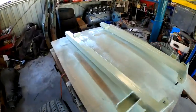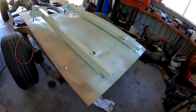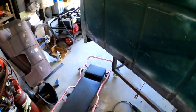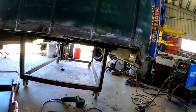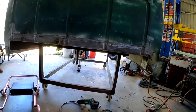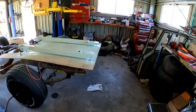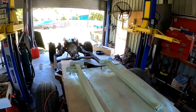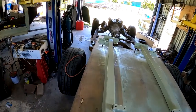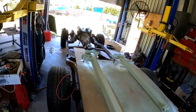I went ahead and cleaned up the chassis rail adapter dags and got them painted in epoxy - just curing now. I've been getting the underside of the cab finished up and cleaned up, ready to sand underneath and get it all buttoned up. Then I'll put primer on the bare metal spots, and once everything's cured I'll paint these rails and get the cab back on the hoist. Get the rails touched up, bolt them up under the cab, then I can start the chassis disassembly - get it bare metal, primer and paint.